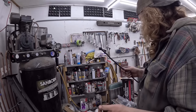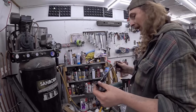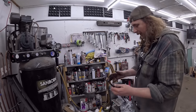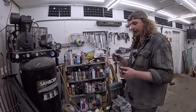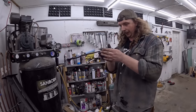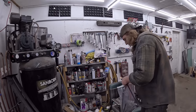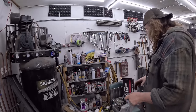So I assume you want to have the transmission in neutral. We'll do a little reading on the instructions and kind of jam this all together — a pretty simple setup. The thing is, this has a little kind of bend in it. I bought a transmission for my Nova — at some point somebody had jacked it or lifted it and bent all these rods to hell. That's a nightmare because all these rods get real tight together — jammed up, bunged up, adjustment in and out. It would get stuck in gear. Nightmare. So you know what I did? I stopped driving the car, instead of spending a few hundred dollars on new rods. But such is life.